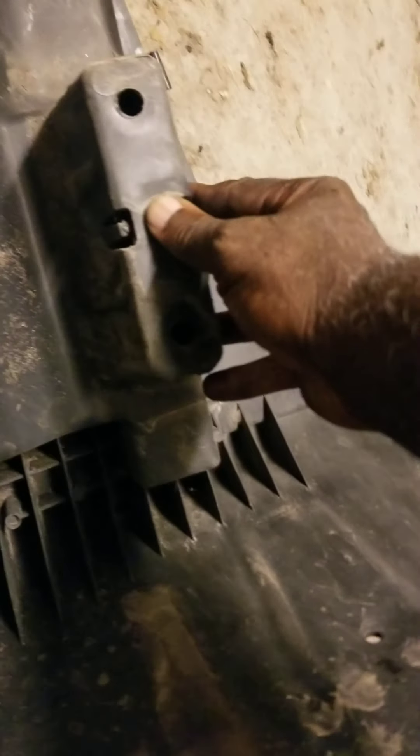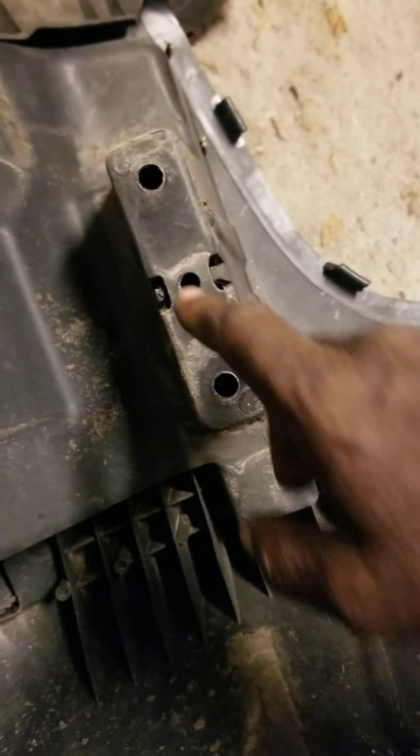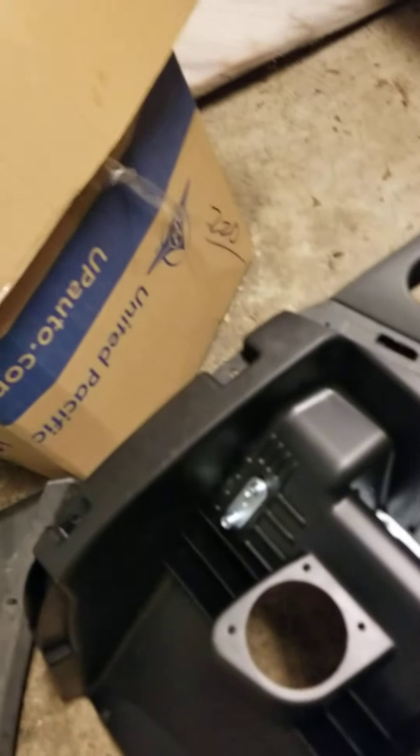On the inside here, you're gonna see this from the inside and you're gonna have to have a drill. It's all riveted, so you drill this hole out. Then you're gonna have to drill out the rivets — there's screws, there's rivets up here behind here, there's little plastic things that hold this cover on. There's a couple of rivets you have to drill out in order to separate both pieces, and that's where I'm at right now.